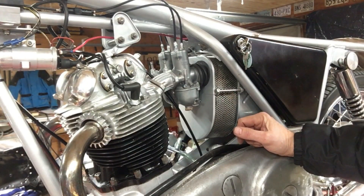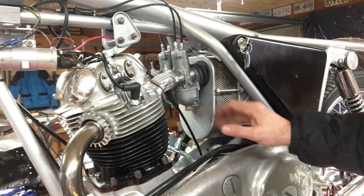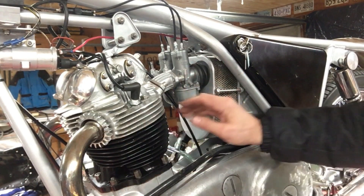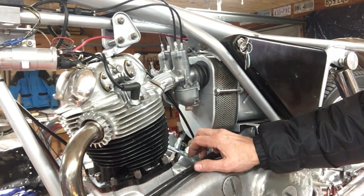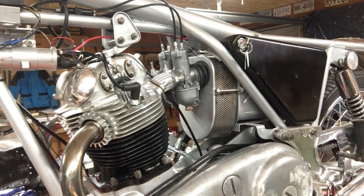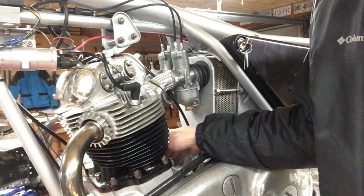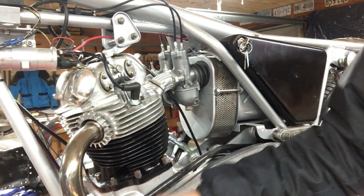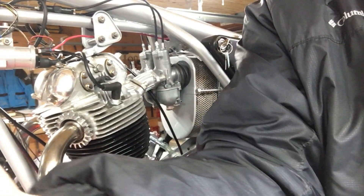Okay, I'm going to do the other side now. That's it for tonight — I'm not going to fire this bike up tonight. It's getting late, about 9:30-10. So tomorrow: put the gas tank on, fire it up, put the timing light on it, make sure that's set. Hopefully this bike runs perfect — that should be it. I'm going to re-torque the head one more time, and then I can focus on all the little crap and get the wiring done. I just haven't been able to go forward because I haven't been happy with the way this bike's running. I got it running on two but not good enough, and I'm hoping those new carbs are going to be the trick. I'm pretty sure they are. We'll get this bike all buttoned up so I can get onto the next project. That's it for tonight — we'll get this thing going tomorrow.